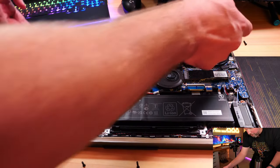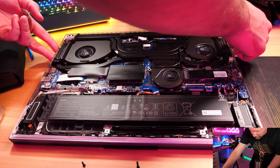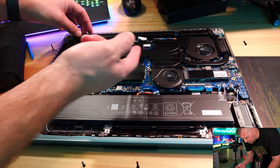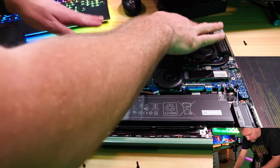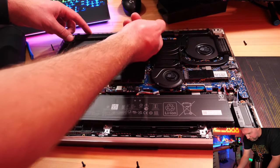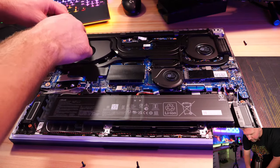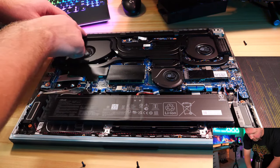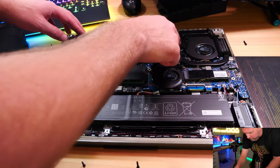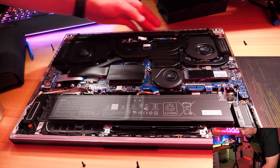And yeah, so we have four fan exhausts, well, I guess it's more like three. You got one on each side, and then you got one huge one along the back. But the back area primarily is being cooled on the two sides over here, where the air blows out right here and right here. This third fan does move air out the middle here, and I'm sure the fins also can help distribute heat across everything, because there's this really long heat pipe that goes across all of the fins, and then these probably cool the other heat pipes here. So it's a really interesting thermal design, the way they're distributing heat across the entire rear of the device.